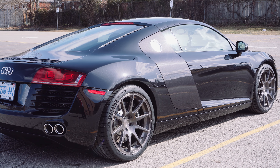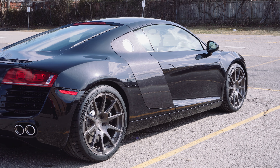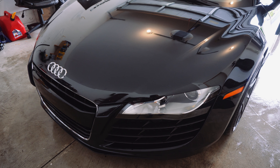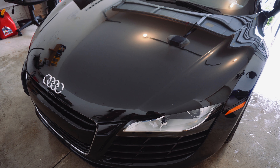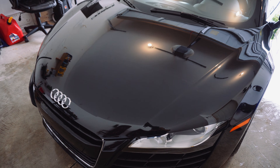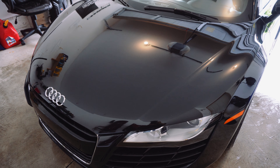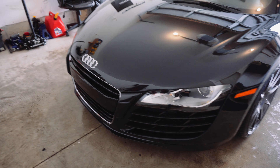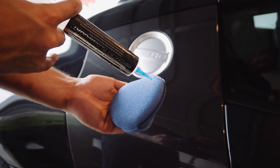First, it's going to protect from all the UV damage, bird droppings, water, and dirt. It's even going to protect from some light marring or swirls on the paint, because the ceramic coating is actually harder than the clear coat on your car. The ceramic coating is a huge evolution over a traditional wax because of all those things, plus its durability is just incredible. In this case with Optimum Gloss Coat, this ceramic coating lasts two years.